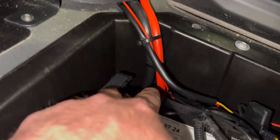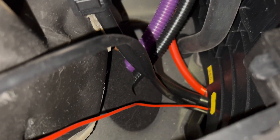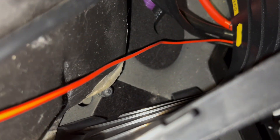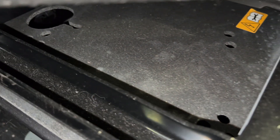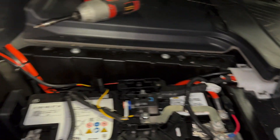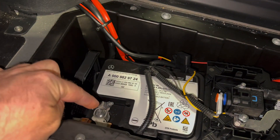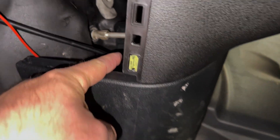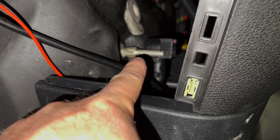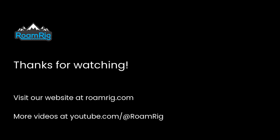There are many grounds that you can use. If you go to the end of this black cable, there's a ground wire right under there — you can ground under this stud if you need to. You can ground to any of the ground points under the driver's seat. There are a million other places to ground. Don't ground between the battery and the end of the battery cable, because then you defeat the ground disconnect.